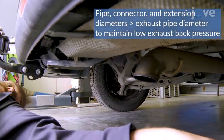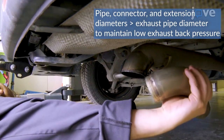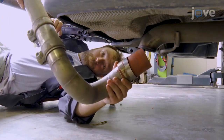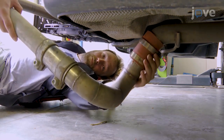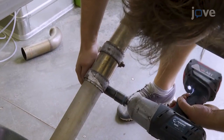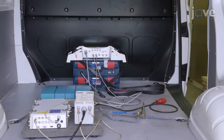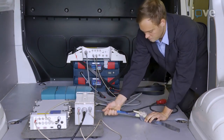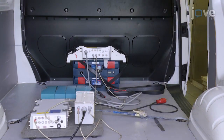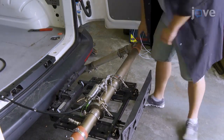Check that the connectors from the exhaust flow meter pipe to the exhaust pipe of the vehicle can withstand the exhaust gas temperatures. When the exhaust flow meter has been installed, use connecting pipes and pipe clamps to connect the exhaust to the first pipe, tightening the pipe clamps at the end only to facilitate alignment of the pipes during the fitting. When there is a connection from the exhaust to the exhaust flow meter, place the exhaust flow meter control box and the exhaust flow meter mounting bracket into the trunk to ensure that nothing slips during the measurement trip, and check that all of the piping is tight and that nothing will come loose during the measurement trip.